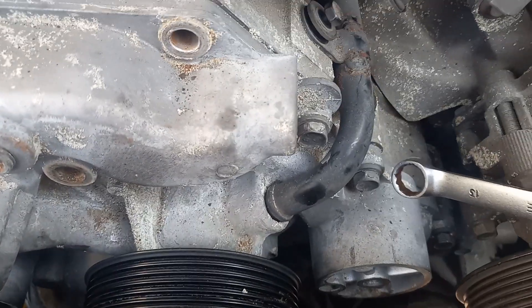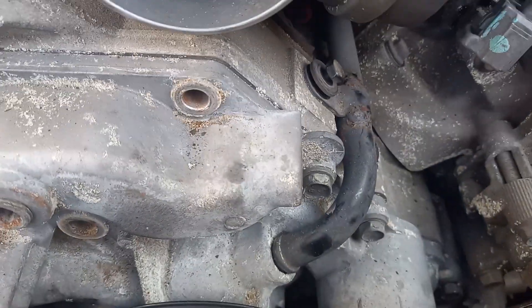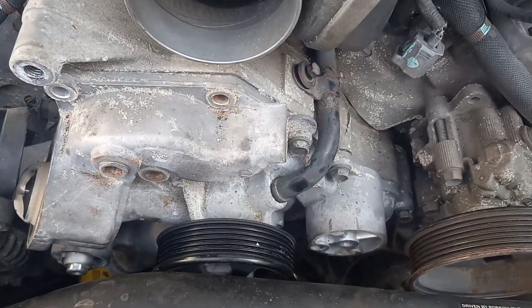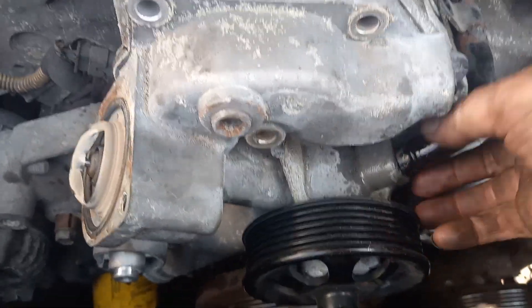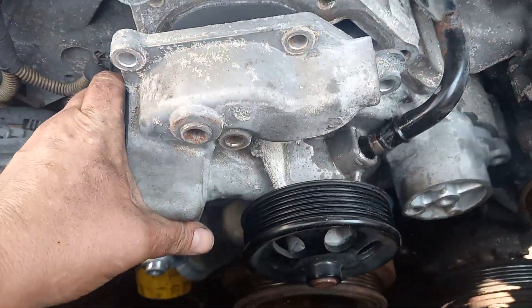I got two more half bolts that are already loosened. Then this tin that comes to this pipe, which you've got to be very careful with. After you move that, the water pump should come off — make sure you get the bottom hose off, which I didn't mention. It goes right there on the bottom of the water pump, bottom to the radiator. With a little work, a little olive oil on here, popped it out — didn't break none, smooth. Your water pump is off.